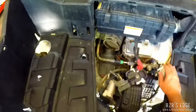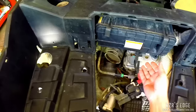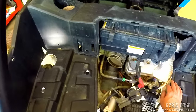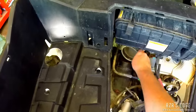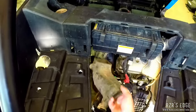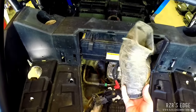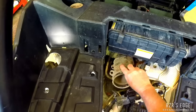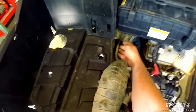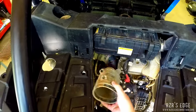Here is the entire reason I wanted to do snorkels — one of the main reasons. I'm not a deep water person. I don't plan on being chest deep in a creek or pond anytime soon. But I have wet my belt on this machine just doing a creek crossing and simply washing the vehicle. One of the key points is this is your belt exhaust — this is the lowest point of opening into your belt on the machine. It's very susceptible to splashes, as you can see from how dirty it is inside. It actually has one little clamp that holds it on — just pry it out. There could be a hose attached in here, so just make sure you don't mess it up. There should be a little grill over the end of it — just take this thing out and put it in your collection of extra parts.